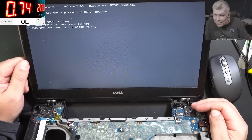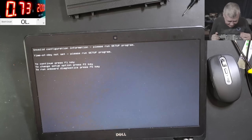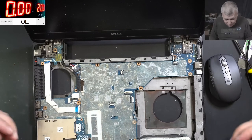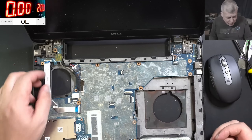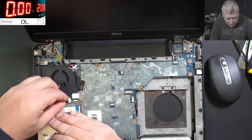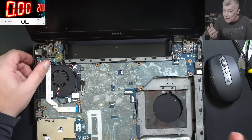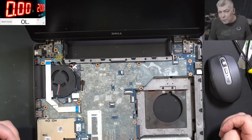And we have a picture! Can't believe it was only the capacitor. Lucky me — Friday job, it's working. I didn't expect it to be that simple — just an easy job. Dell, capacitors — but it's not only Dell, it can be any laptop. This is a common fault: when you see a short on the main power rail, you can be lucky and it's a capacitor, or most of the time it's a MOSFET — but that's more on gaming laptops with shorted MOSFETs, not these ones.